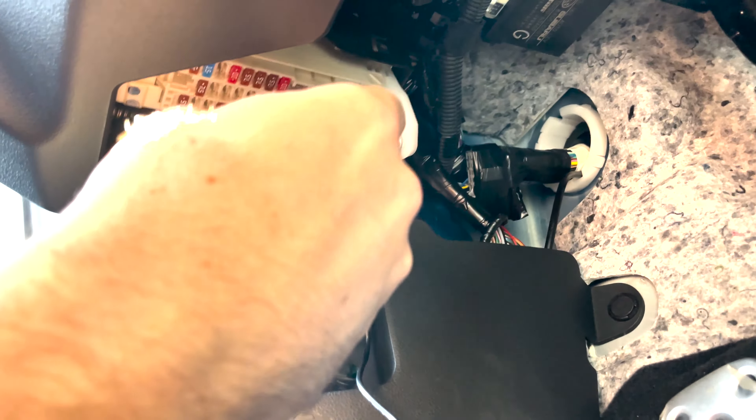We check the low voltage cutoff settings. The top setting is for 24-volt systems like a UTV, so we leave that alone. Tommy parks at home or work so he's not too worried about parking drain, but we set the low voltage cutoff to maximum so it shuts off the earliest - at 12.4 volts - to protect the battery.